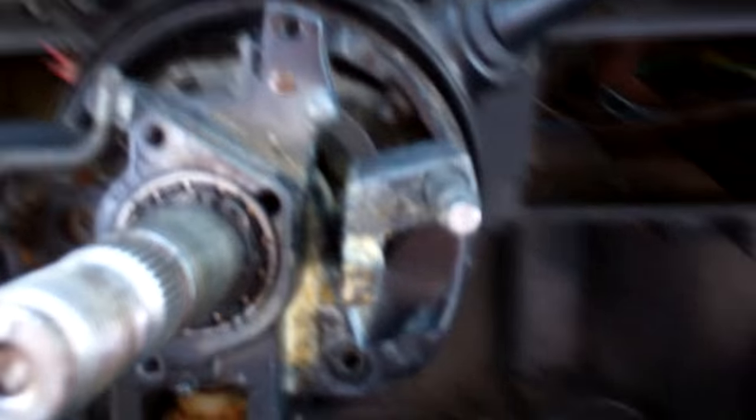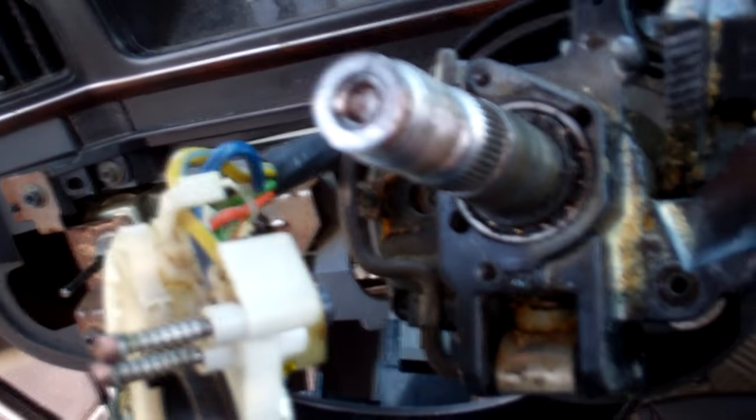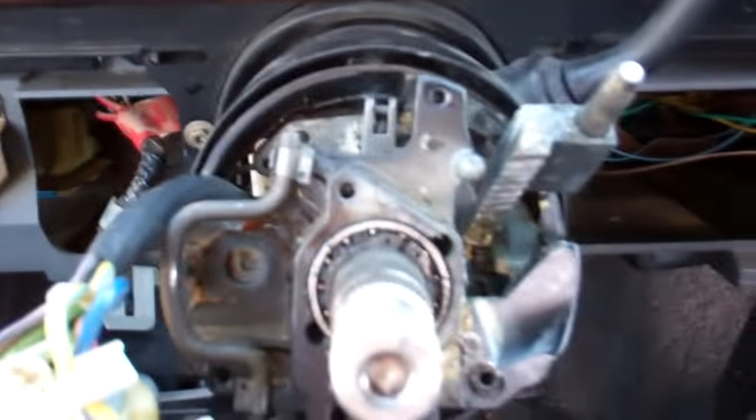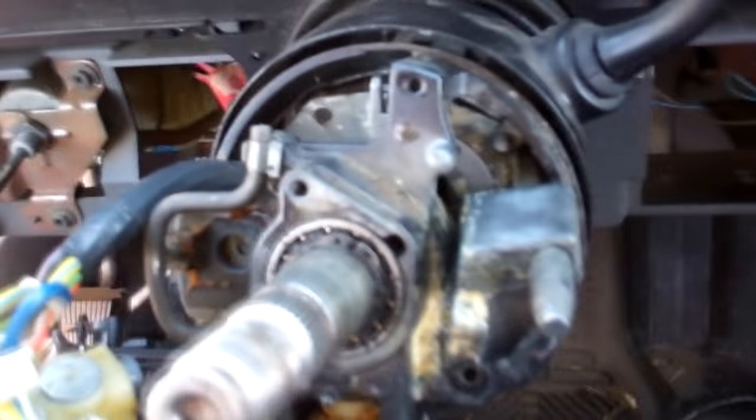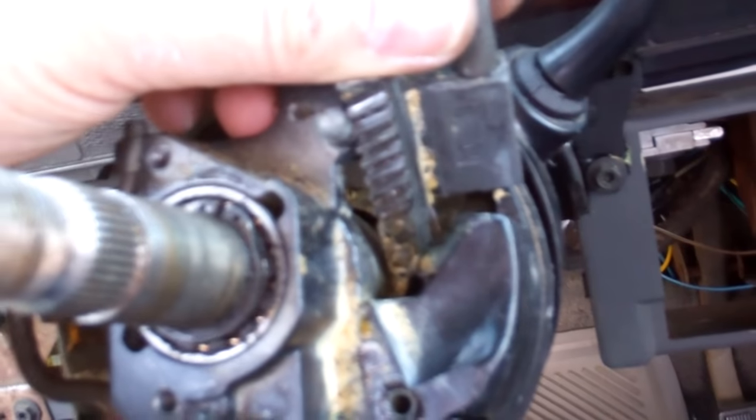And that's what was really causing the key to be hard to operate. While I have it open, you can see there's a rod that attaches to this that goes down the column onto your ignition switch, and moves it back and forth into the different positions for on, off, start, and accessory when you turn it back. For the tilting mechanism to work, there's kind of an eccentric on this part that allows it to move back and forth, and then it has to transfer this in-and-out motion up top to run that rod down there. The switch is not actually anywhere in here like a lot of people think — modern vehicles have the switch on the end, most of them.